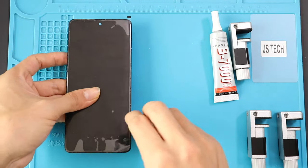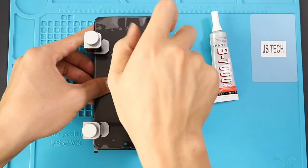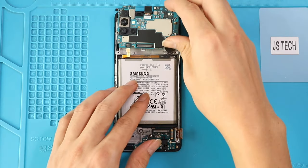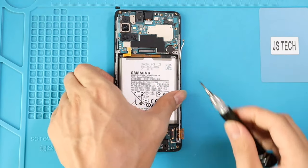Next, add binding clips or rubber bands to bind the screen with the frame. Then place the logic board by adding the screw and then plug the antenna, LCD, battery, and main flex connectors to the logic board.